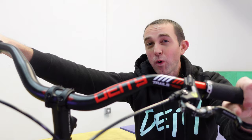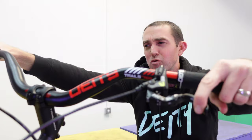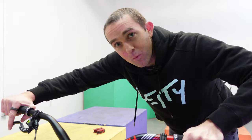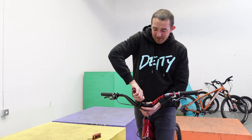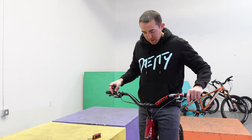One piece of advice if you're setting up this bike for the first time: on the brake lever there's a tiny adjustment knob about halfway down, and it will take your Maguras from zero to hero. It's crazy how much turning that one bolt makes a difference in braking power. If you're having any trouble with the brakes, try that knob — you'll be surprised how much better they work. This bike just feels lighter and like I'm going to be able to throw it around better. It's a little higher spec than the Foreplay Pro I previously had, but I expected it to weigh more just because of the wheel size — so I'm pretty excited.